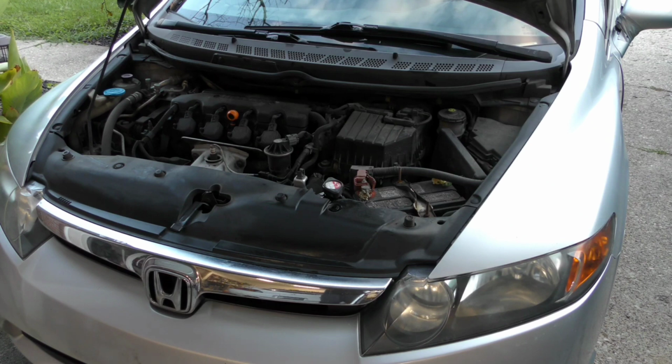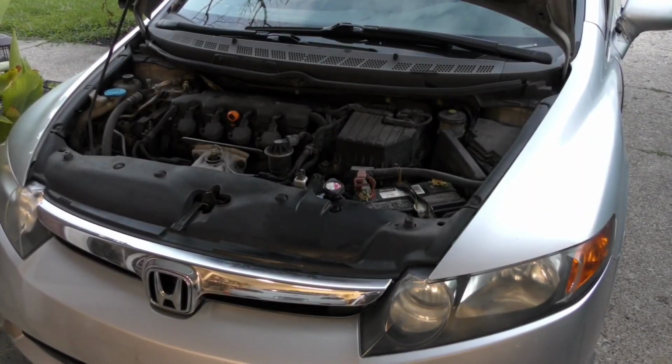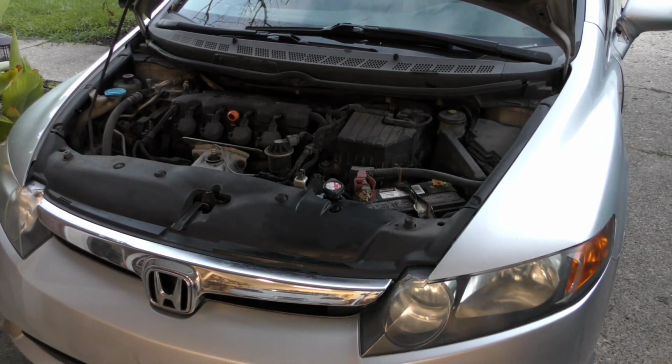Like I said, when it cycles 2 times, you turn the car off, top the coolant off, and that's it. We've got all the air out of the system now. It's a very simple process on a Honda, not like other vehicles like a GM or what have you. There you go. That was the second time the fan just cycled. Now I'm going to turn the car off.